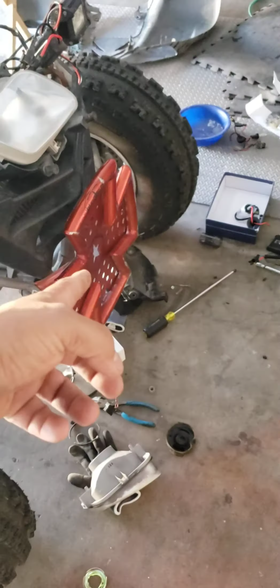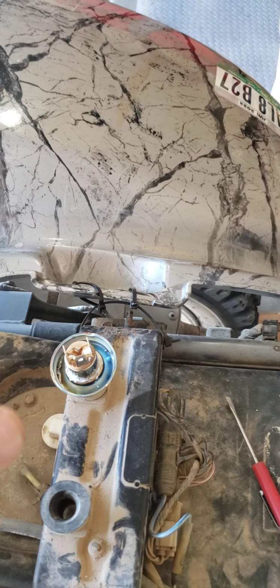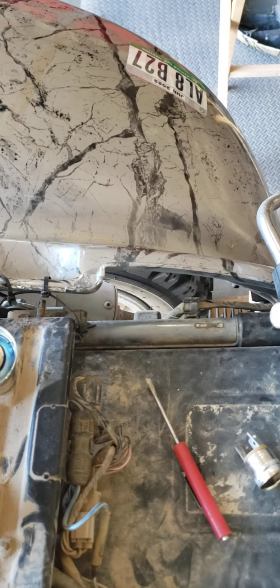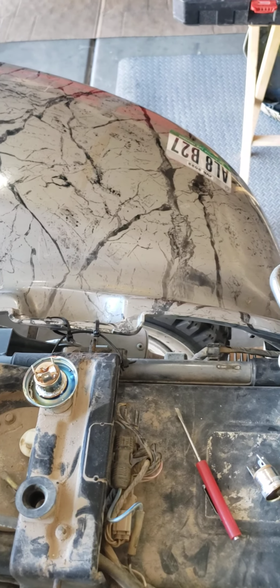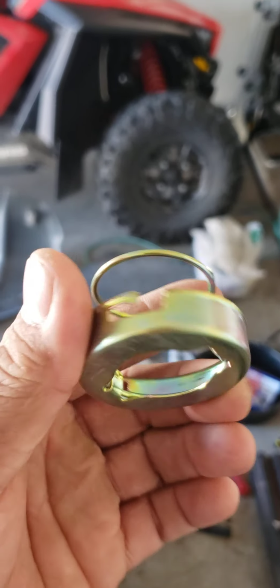There you go, guys. Like I said, sorry I couldn't be more in depth in showing the actual mounting in the back where you take off that plastic black piece. But yeah, like I said, you remove this upwards and then you modify your HID or LED however you want to get it to stick in there. You pop that in first into the headlight, then you put your HID or your LED in there. Once you do that, you put the back spring, which is this little twister right here, and that will actually hold everything in together. It's just a push and twist.